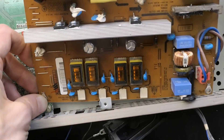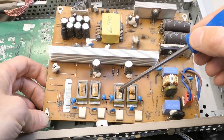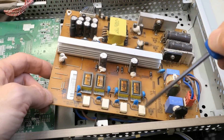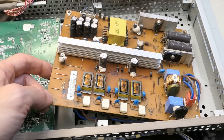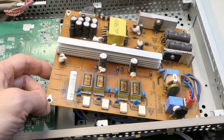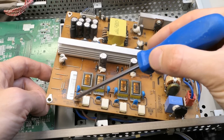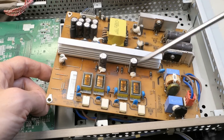Here's the CCFL part of it - some switching transistors switching the primaries of the high voltage transformers. In this case each CCFL tube has its own transformer; in some cases there was a transformer for each pair. These high voltage capacitors are limiting the current, or some might be resonant capacitors parallel to the secondary, and the others might be in series with the lamps limiting the current.